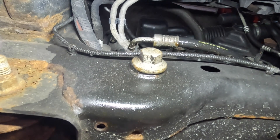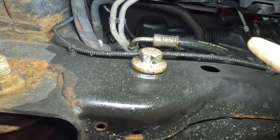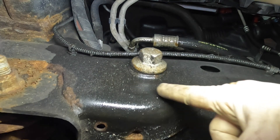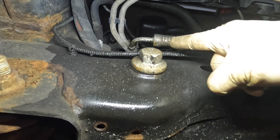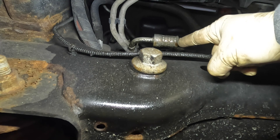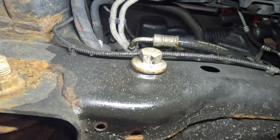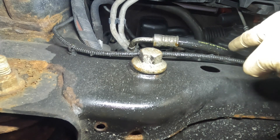I have you guys positioned in the front of the truck. This is the front frame, the engine's right up there. If you notice, this whole frame here is wet and if you follow it up right here, your power steering line here at the compression fitting is basically leaking. This isn't a really bad leak — this was here for a routine checkup. I found a few things going on and the customer gave me the okay, so today we're going to tackle the power steering hose.